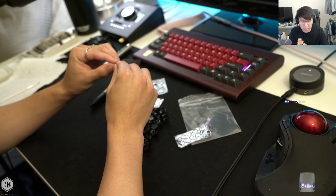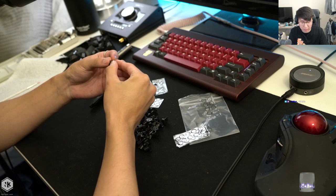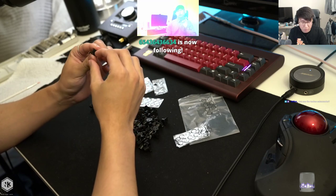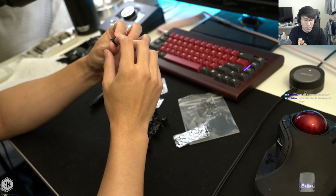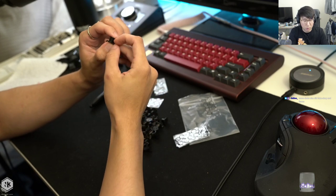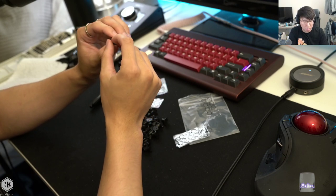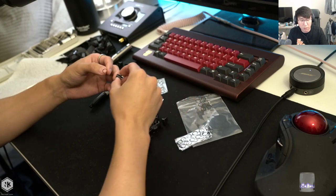A Virtues, these rings silence the upstroke? Yes, that is correct. So some people have complained that the Silence X-Rings slide up the sliders and then come to bind against the keycap or something like that. I've personally never had that issue. I'm wondering if those people complaining actually put these rings all the way flat, all the way at the bottom. That's what I'm doing right now, and I did for all my previous Topre boards. It's been almost half a year since I've been using them. Haven't had one single key with the rings slide up. So I'm not sure if I'm just lucky or people install them incorrectly.